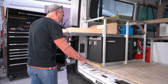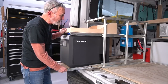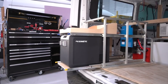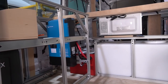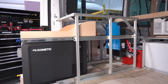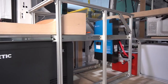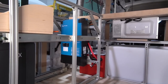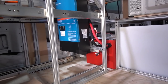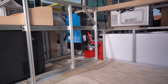What you may not see back there is the inverter — that Victron inverter. This is where I chose to put it. It's on the tail end of the whole framework for the cooler and the storage shelf. It's actually an ideal spot — hiding in plain sight. If I have to service the inverter, I just remove these two drawer glides, take the sleds out, and I can crawl right in there. The big battery — the red battery — is sitting right behind it. If I've got to swap out that battery, I have to unbolt this entire framework from the floor, slide it over in front of the water tank, and slide the battery out.